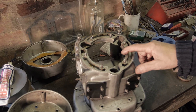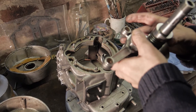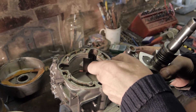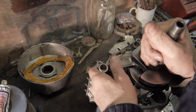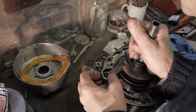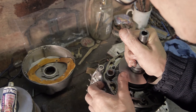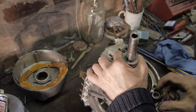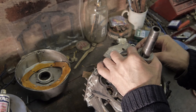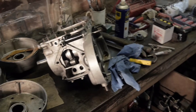We're having our upgraded Alpha main bearing, Alpha roller bearing big end conversion — not cheap, but it will last indefinitely, as opposed to the rather fragile situation where the existing big ends are really too narrow for their usage. It is the weak spot of these engines.